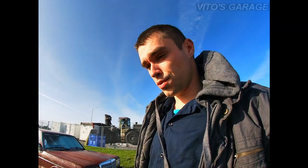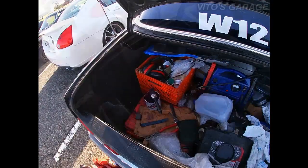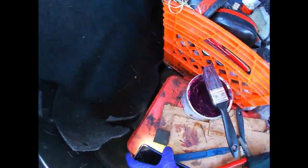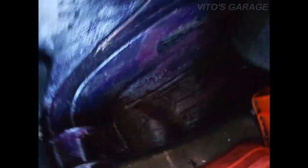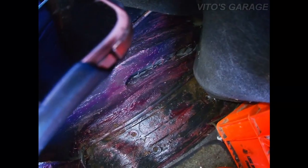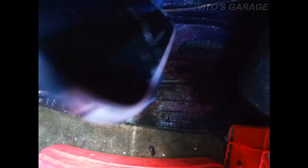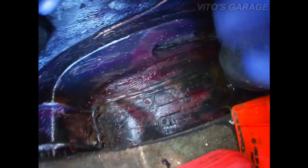This actually applies to all the old-school Mercedes, and even new Mercedes I guess. You gotta check these pockets right here — let me turn the light on for you guys. It's not really a temporary fix, but I'm checking these pockets because usually what happens on these old ones is that water stays in here due to a bad rear windshield seal or something like that.